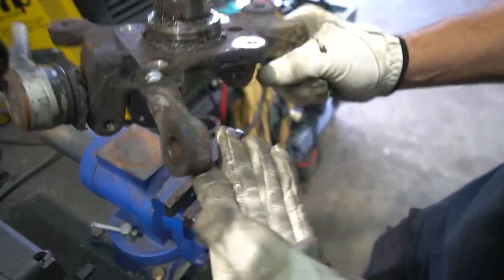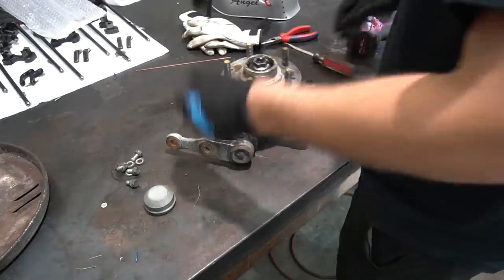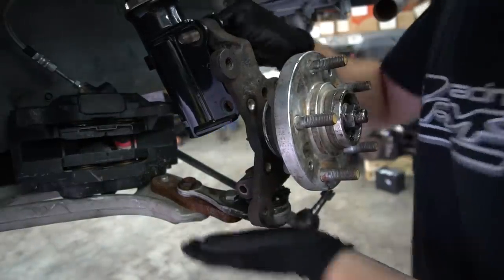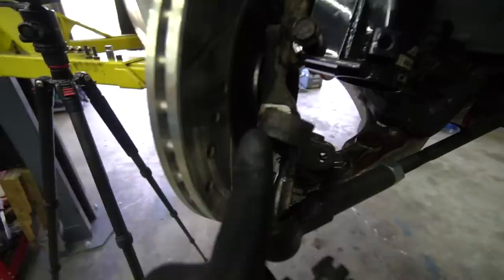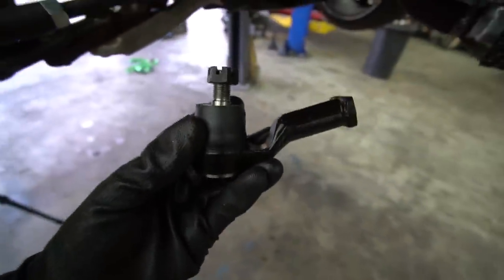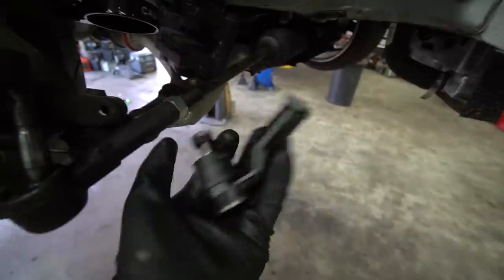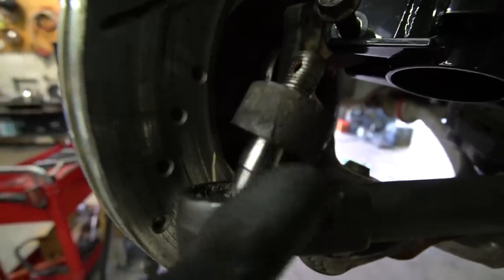We've got this one tacked up — throw it on the car, see how it fits. So I maintained the factory angle of the pickup point. As you can see, the stock tie rod is angled up to account for and prevent bump steer. Whatever tie rods these came off of, this inner is different — this one doesn't thread onto it, and this is flat. So if we maintain that same kickback, you can see that just at static ride height this tie rod end is completely maxed out — it can't pivot any further this way.